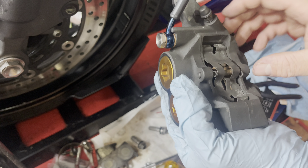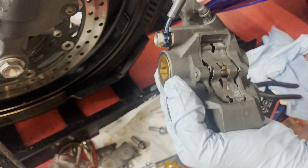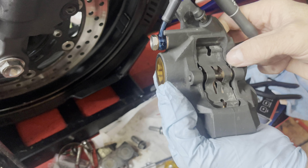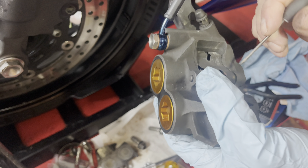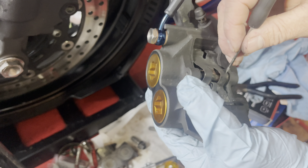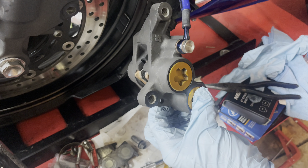Now technically I could just leave it like that, but the way it was before I'm going to move these things to the inside over here just so that they're kind of out of the way and don't hit on anything. Pretty easy. Just by simply doing something like this — you rotate it. Now we have the two little ends sticking out like we did before when we first saw the caliper, so that should be good. Make sure your pads are nice and pushed out and we'll push this back onto the bike and get that mounted on there.